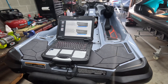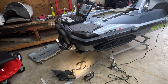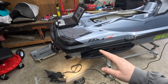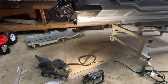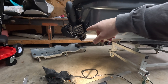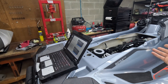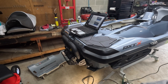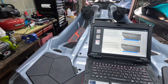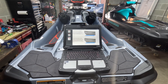Really that's pretty much all there is to it. This is something you can do in 20 to 30 minutes, very easy to do with the ride plate still on the ski — there's no need to take it off and send it off to anybody. Just a flashlight, a straight edge, and a cheap belt sander, and you can have this entire process done. It's an easy one to two miles per hour gain if your plate is affected. The best part is this modification requires nothing else afterward — unlike the IBR stop grind which needs recalibration, or other mechanical mods that need a tune, this one you just grind, check it, take the ski out, and ride. Leave a comment if you have any questions and I'll get back to you as soon as I can.